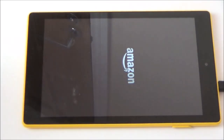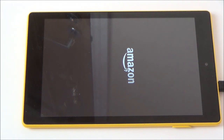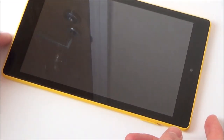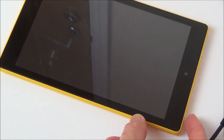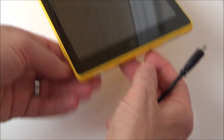So you can see what's happening there — this is what I would call a boot loop, and I had this on one of my Android phones. I was told this was software related, but on my phone I dropped it and the problem happened straight away. I'm wondering if there's something in there that it can't recognise the software because maybe there's an actual hardware issue. I've been reading up about this and there's a technique where you turn the tablet on, plug the charging cable in while holding the power button for about 40 seconds, then release when it turns on. It's worth a go.